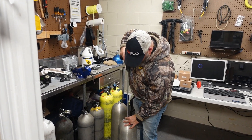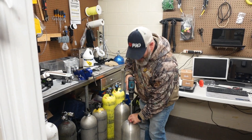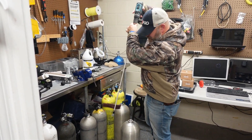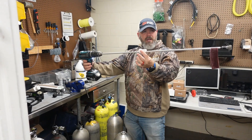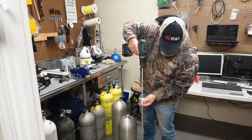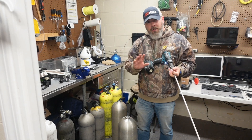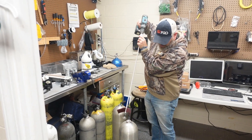What I'm actually doing here is getting rid of all the hydrocarbons in the cylinder. This system is just a Brillo pad on a long pipe or drill bit, and I'm sticking it down in the cylinder. As I'm spinning it, you can see it going through and cleaning the entire internal side of the cylinder. I do have a soapy solution in here to get rid of hydrocarbons.